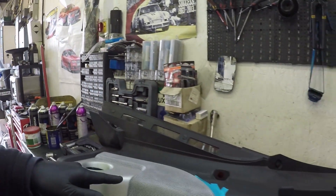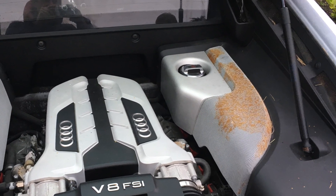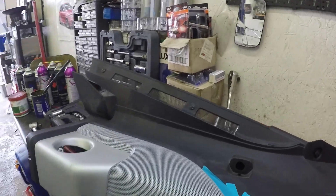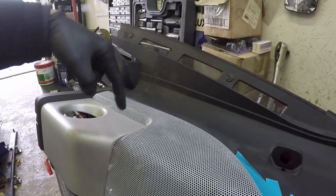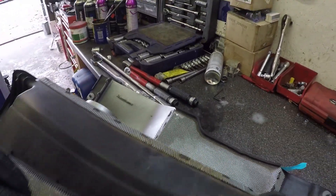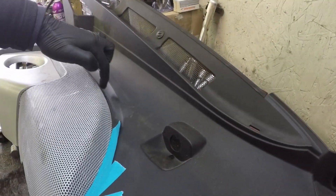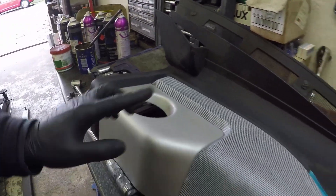In the meantime, the trims that were on the engine bay are now not on the engine bay. I was going to send them to a body shop to paint the rusty bit, but I actually had this silver Hammerite in stock for another job and I thought I'd try it on a small area and it went on really well. So I've done most of this now. The tricky bit is that they're three-dimensional, so if you've got corrosion it's not just on the top but in the holes as well, so you have to paint top and underneath. The metal bit isn't removable from the plastic — it's plastic welded in place — so I'm doing it in situ, being very careful with the masking tape.